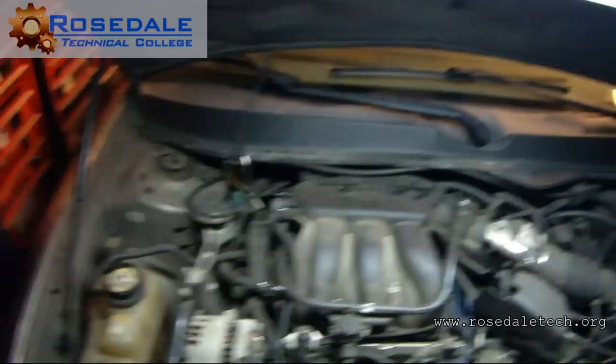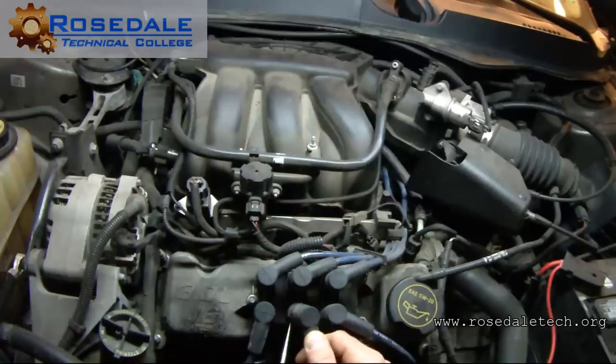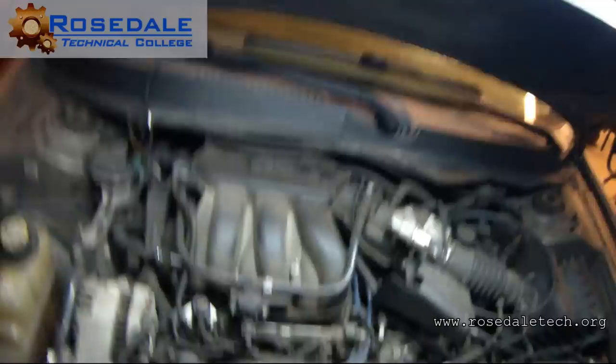We got good spark, but listen to the engine. Forget the spark sound. No droppers. We want it to change RPM? We absolutely do, because what we're doing, Jess, is taking that spark away from that cylinder. We're preventing it from firing, so that means that cylinder, because there was no change, is not firing. Does that make sense? I'm pretty sure it was a misfire. Next.